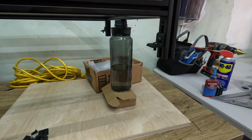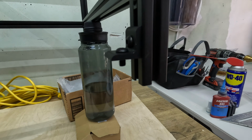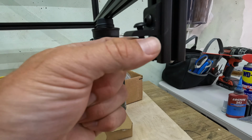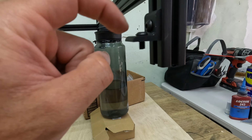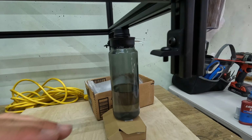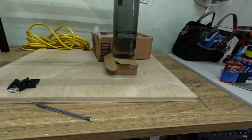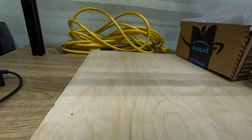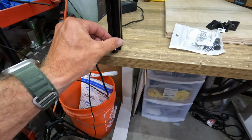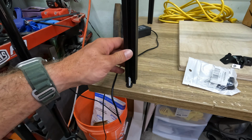So basically what we're trying to do is these angle brackets, or these corner brackets, are going to sit right on that mounting bar, and we're going to have this 1/2 inch quarter 20 go into that T-nut in the mounting bar, and everything's going to sit off the mounting bar. And then I'm probably going to tap these quarter 20 little legs in here, so if I need to adjust this when I have it in the truck, make sure everything's level.